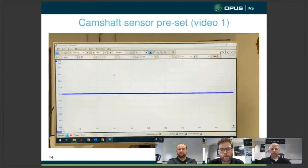We're going to show you a couple of videos now. We had a transporter in the other day — a two-litre common rail transporter — and we're going to show you how easy and quick it is to set your PicoScope up and start capturing data. People think it's very time-consuming and laborious and it kind of scares them off, but this webinar and the day course are going to try and bust some of those myths. We're going to show a quick check of a hall sensor — a camshaft sensor on this transporter — using the PicoScope's guided test plans, which will show you exactly how to set the scope up, where to put your wiring, how to configure the scope, and what to look for in a pattern.